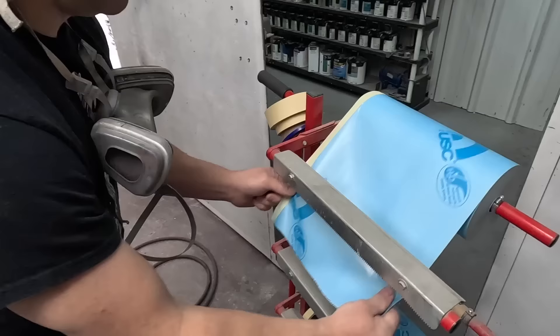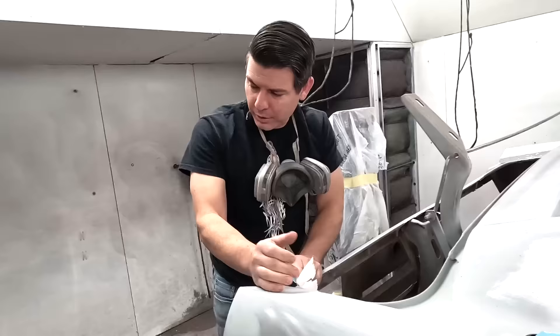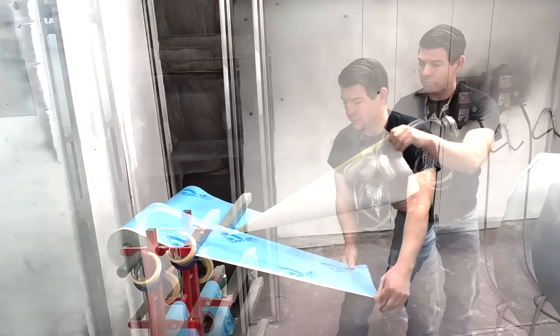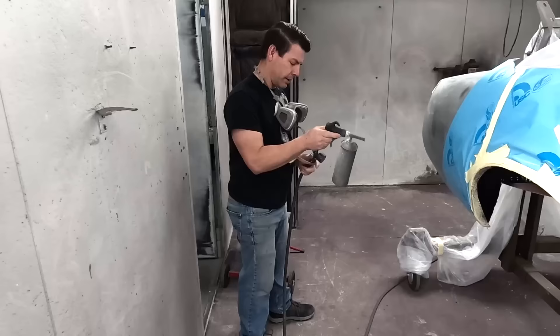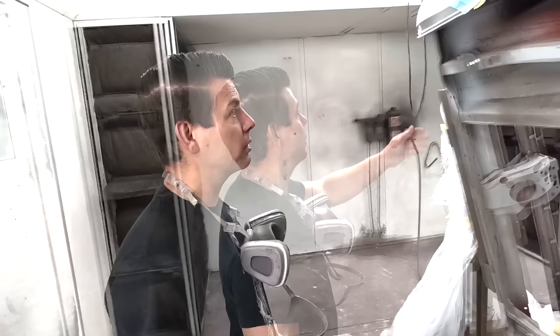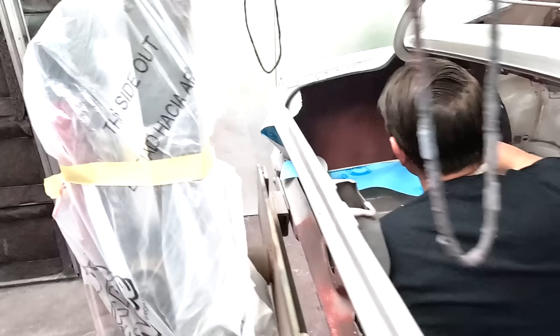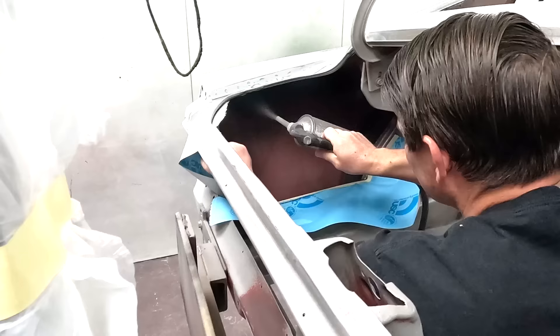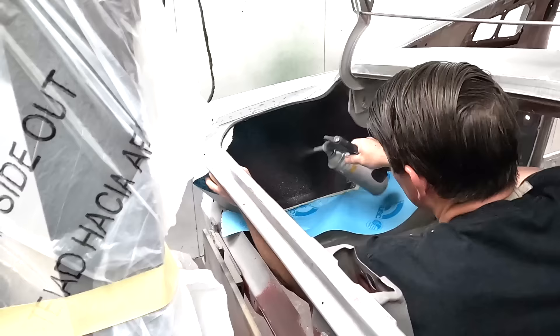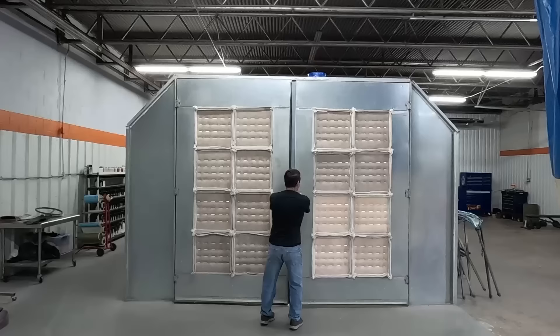Next I'm gonna do it on the inside of the quarter panels, and I'll actually do a little masking because they had some straight lines in there where they kind of masked it off. They put it in the inside of the trunk for sound dampening purposes - that way it wouldn't sound like a tin can. On the inside of the quarter when they actually sprayed it, it was droopy and runny and pretty sloppy. Today's products - I try to do the best I can. I've tried different applicators and they're all too smooth, so I just keep coming back to this because it's the easiest product to use. I'll do a heavy coat and then go back after it dries a bit and put a lighter, rougher coat on it.